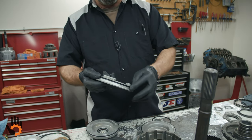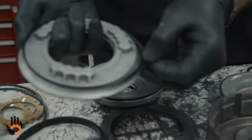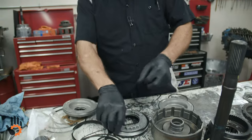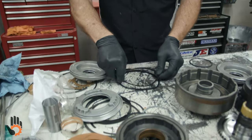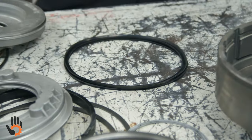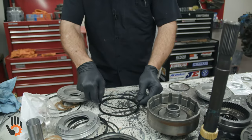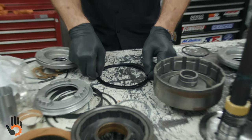You're going to put one on your intermediate piston. Now, see there? We've already mixed them up. That's not a good fit. Okay. Just take this one back off. Lay them back out again. If you can see all this or not. Okay. Got two here. Those were our two that were the same. We've already put one on wrong here. Let's pull this one back out. Looks like I mixed them up as we went. So that one's a little bit smaller in diameter.